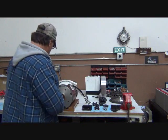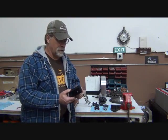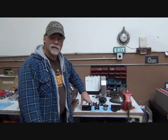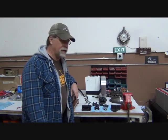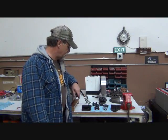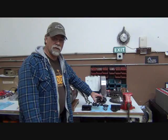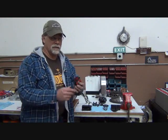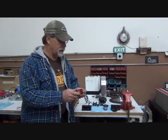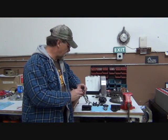Okay. Some of the items that we're going to be replacing are the transaxle mounts. The ones that are on there don't look too bad at a glance, but they're not that expensive, and this is the best time to do that once we have everything out. So we're going to replace the 3 mounts, the 2 sides and the front. Then we're also going to replace the coupler that couples the shift rod to the shifter shaft on the transaxle. So we're going to replace that with a new item that has urethane bushings, and it's a much tighter setup and should last a very long time.